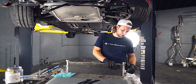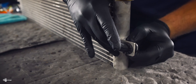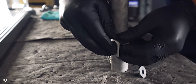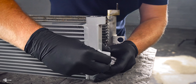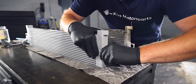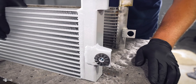We are ready to transfer over the little grommets — there are three: one over here and two over here. The way you do this is take your finger and press out the middle portion — it just holds it in place. Squeeze it out, rock it up, and do the same thing. Throw it in there like that, make sure it's sitting good. Then take this metal piece and put it in the middle to make sure it's not going anywhere.